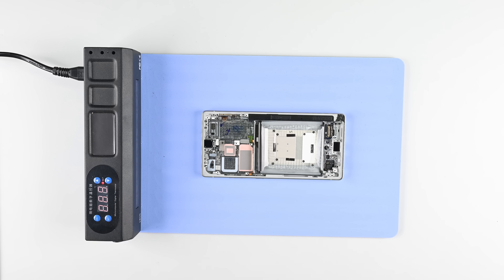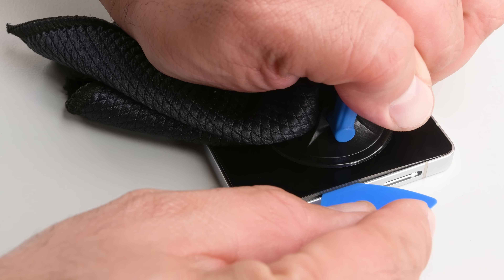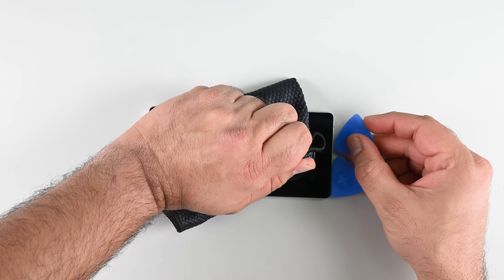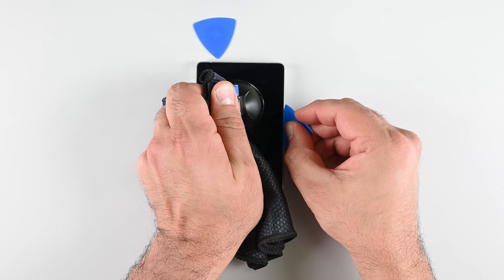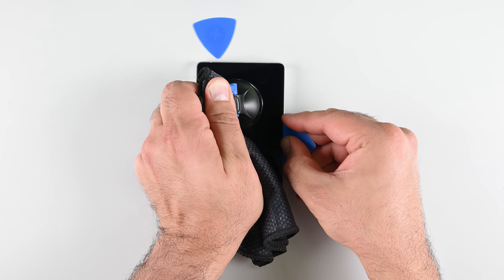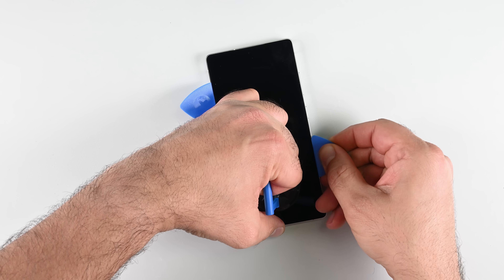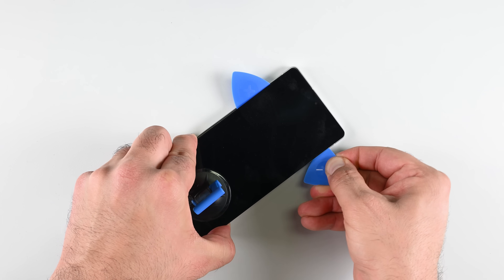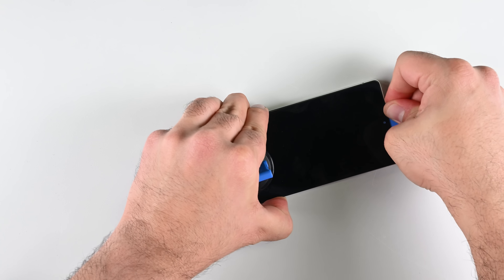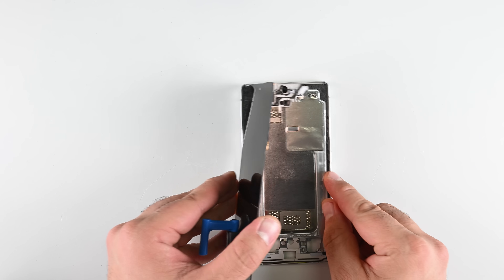The screen is coming away next, and this one is daunting. I've applied a ton of heat — 150 Celsius for three-minute bursts — and it's burning hot to the touch. Still, it's a royal pain to lift the edge up enough to cut the glue away. You can remove the screen safely with practice and patience, but it's not a fun experience. My advice: don't remove the screen unless it's already broken. Despite ditching the curved edge panels, Galaxy screens are still too difficult for the average DIYer. The saving grace is that you won't need to remove the screen to access any other repairable components.